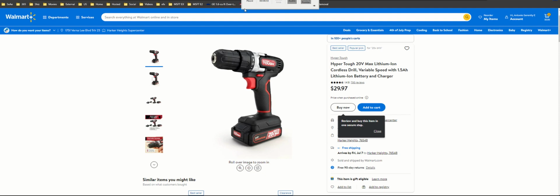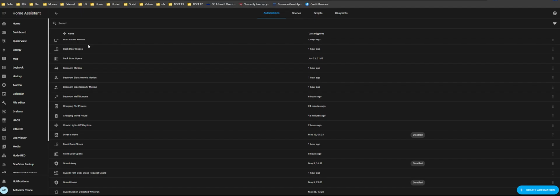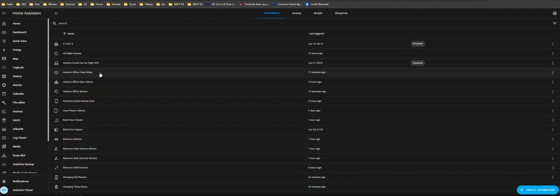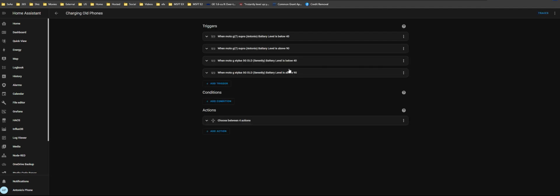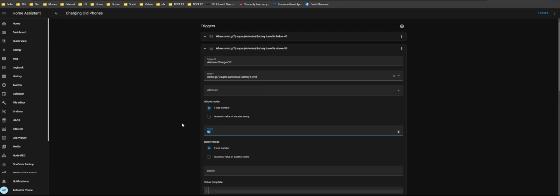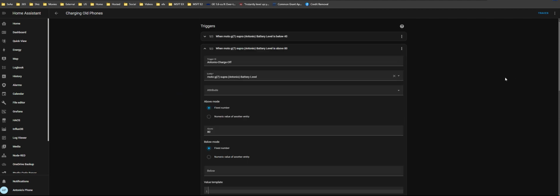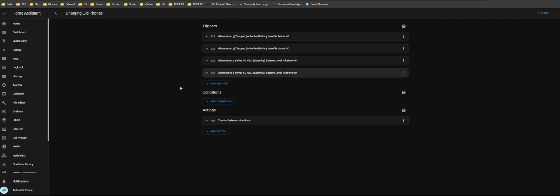Okay, so I saw somewhere on different sites they have different information. I'm going to go with 80% at the top, because I saw somewhere where it said 60, some people said 80, and this is what will allow your battery to last a little bit longer. So I'm going to go with a roundabout number and change it to 80%. Now, you don't want to take it to 100 because that will shorten the battery life. So I would say just keep it between 40 and 80 and it should do just fine, and it should prolong the life of the battery.